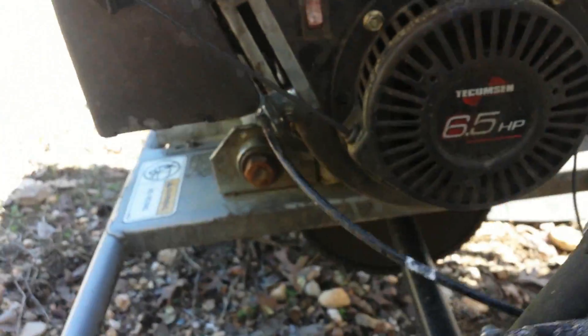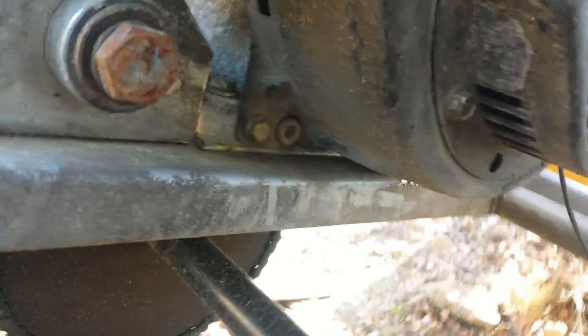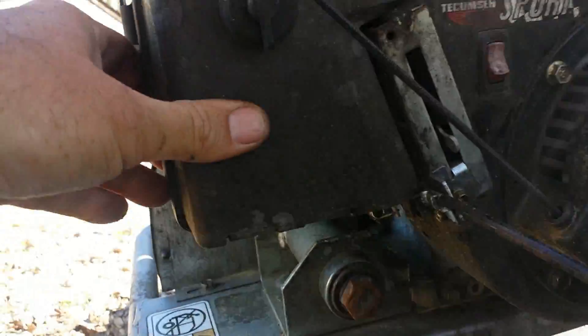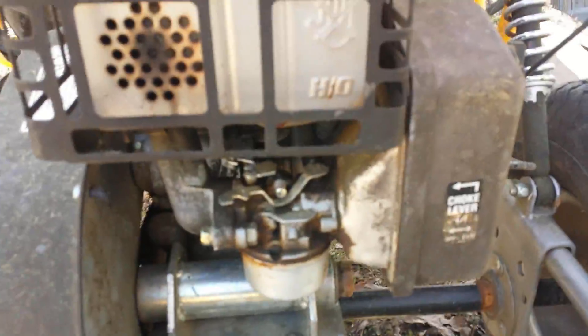I was talking to Nick, the car guy, about the throttle on this having a stop with an adjustment screw. There is a throttle stop screw in here somewhere that lets this thing go a little further — I don't see it at the moment, but I got in there and found it. These things are strange — the governor is what works the throttle on this directly, is what closes it. But only this spring comes from your actual throttle. I don't like that — it makes doing anything to it a pain in the butt.